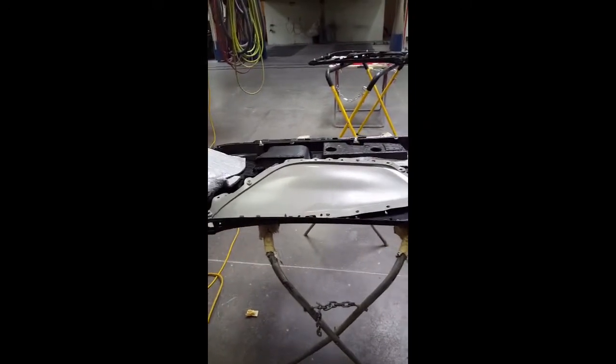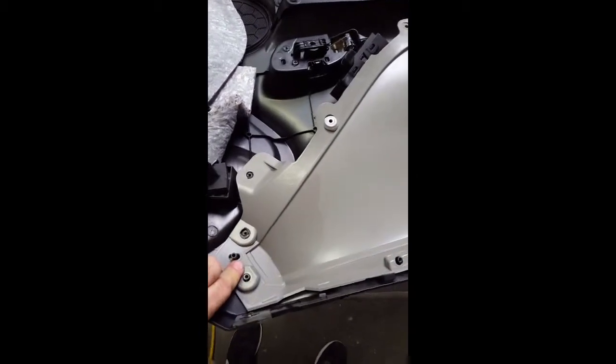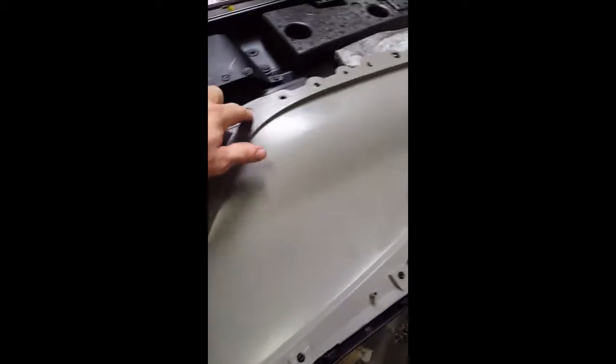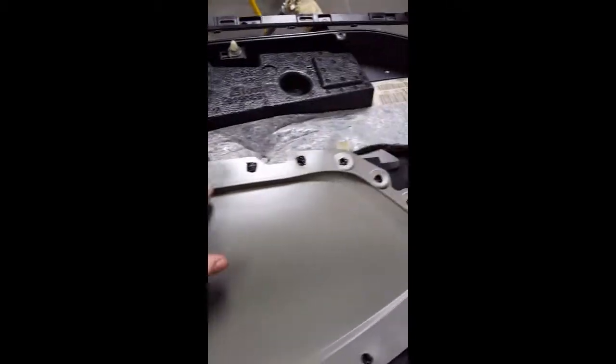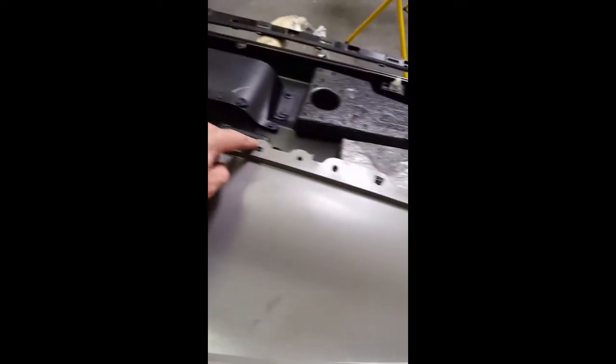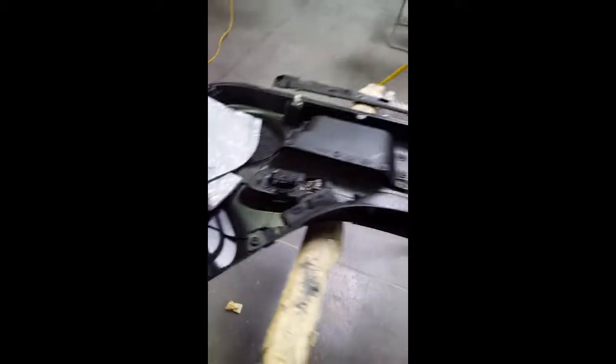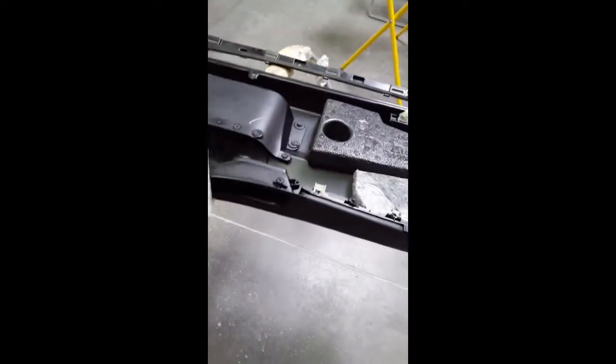Okay, we got one of the door panels off. It's flipped over on its back side, and how these panels are held on is by spots where the plastic's melted in. I basically took a heat gun and pried up, and basically you're breaking the plastic rivet, but once you get that out of the way, it's off. So another thing I liked about the SS's compared to my V6 was the padded stitching on the door panel.